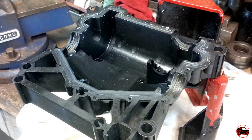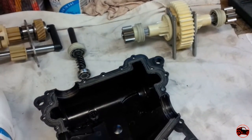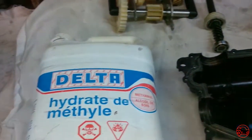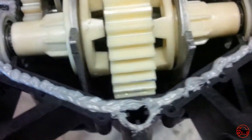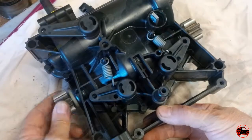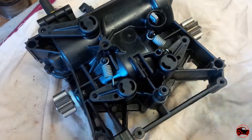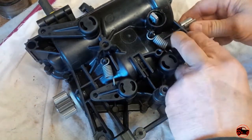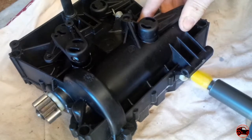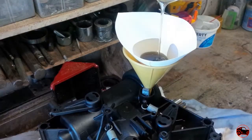I was satisfied with the test and I removed all the components to clean the housing. I used methyl hydrate to degrease the edges to make sure the new silicone would hold well. To seal the housing, all the contact surfaces were covered with silicone. The assemblies were put back in place, the housing was closed and the screws were reinstalled. To make sure the transmission would be well sealed and strong, I waited 48 hours before testing it. Here I showed the gears used for the wheels that turn when I turned the clutch lever to engage the clutch. It worked normally and it was time to put back the oil in the transmission housing.